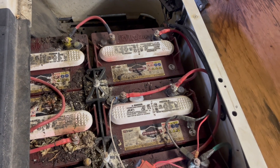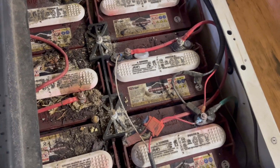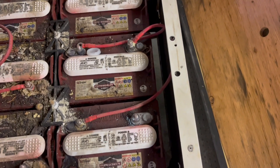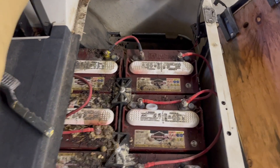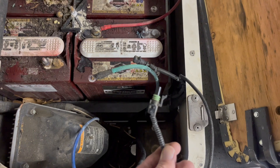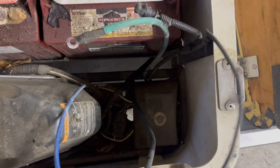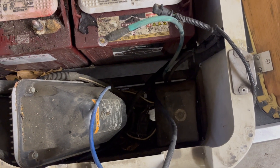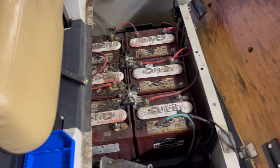This goes to the charge port so the charger would know how much voltage it was working with and could operate the lights to tell you what was going on with the battery pack from the EZ-GO charger. There is one other wire that goes from the charge port to the controller — it's a blue wire coming out of the charger that connects with this connector to an orange wire. It follows along under the seats and goes down into the controller. This needs to have 48 volts or else the cart thinks it's plugged in and won't drive, so this should just be wired to the 48-volt positive of the new battery, or it'll turn on but won't drive at all.